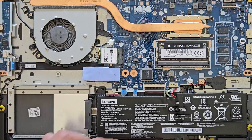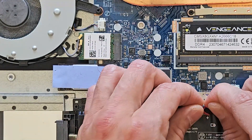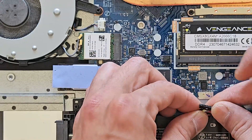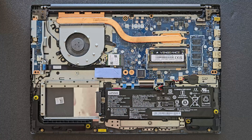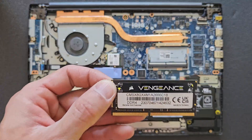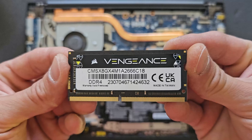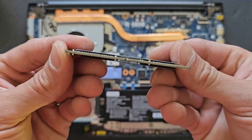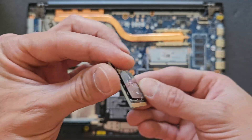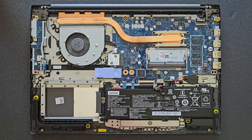Okay, we're going to upgrade the RAM now. Before that, just disconnect the battery — pull out that little plastic connector, it comes out easy enough, longer nails will make it easier. Once that's done you can remove the RAM. As I said, there's 8 gigs at the moment — we're going to swap that to 16 gigs, lower speed because I don't have the same speed RAM that was in it, but there's going to be more RAM overall.